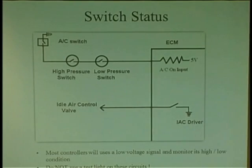So if you wanted to, you could literally go to, let's say, a pressure switch, unplug it, check for voltage here, all right, and then your ground is coming from the other way. I can literally check for voltage, I can ground it here. If it comes on, I just keep backtracking the other direction. So these switches are fed low current voltage.